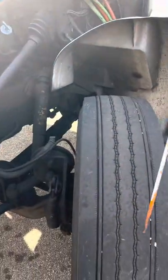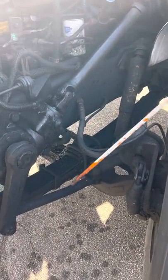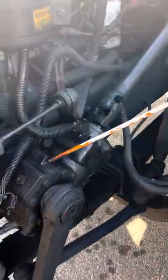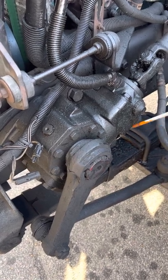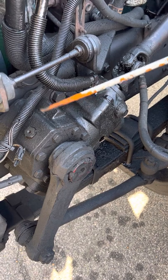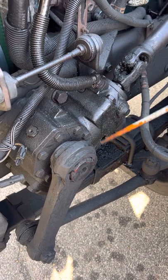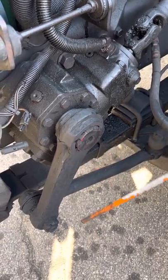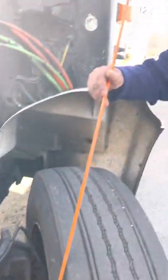We covered the front wheel, front brake, and also front suspension. Now we're going to go to the steering system. Steering system has two points. The first one is this guy — we call him steering gearbox. The gearbox has big bolts as you see them. Make sure the bolts are tight and secure against the frame. The steering gearbox itself is not leaking. All the bolts have to be present and also not missing or loose. The rest of them we're going to call the steering linkage — they are linking each other to make the steering system functional.